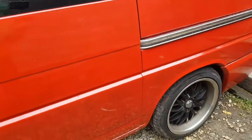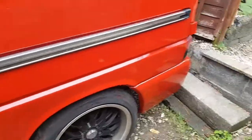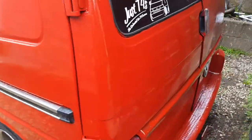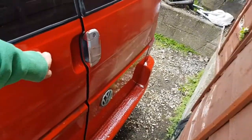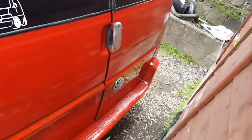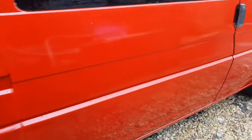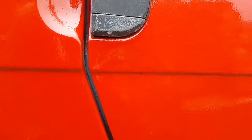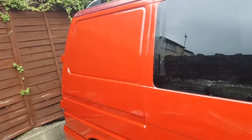There was a big dent on the sliding door, a couple of bits on the rear door. And as you can probably see there's no rear windscreen wiper — they used to be around here on both sides and I filled those holes. Went around and filleted everything else. Just below the door handle along this crease you can see a little bit of the filler working there — that used to be right indented in that crease and I managed to pull it back out.